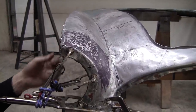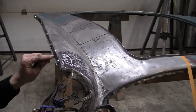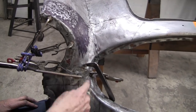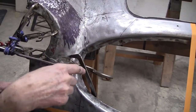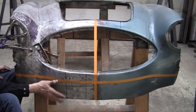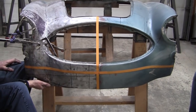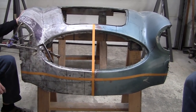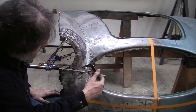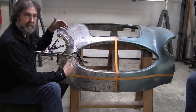That's why it doesn't line up really good — because that has to go way in and then attach over here. We have the broken joint over here we've got to fix yet. So we'll have to grind this weld down, clean this all up really good where all the breaks are. And the next time, hopefully we'll get to weld this together. And then the only major damage that's still left is making this happen back where it's supposed to be. According to the gauge, this edge has got to be rolled, and once we get this side flange and these welded up, we're going to have a nice solid rigid piece to work with, which will enable the planishing to happen even easier.